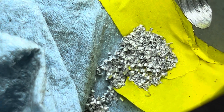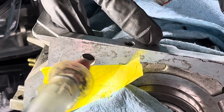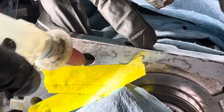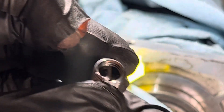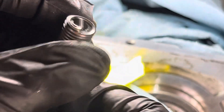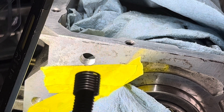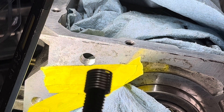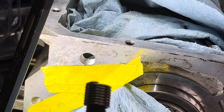All those shavings there. Now we're going to insert our helicoil. Like I showed you before, we're going to take our tool and thread on the helicoil and go all the way to the end — there's that little tab right there that stops it. Now once you start inserting this helicoil you cannot take it back out — you can only go in. So again, very important you start slow and slowly screw it in, because if you get halfway and it's crooked it's not coming out — you'll have to drill it out again and start over.